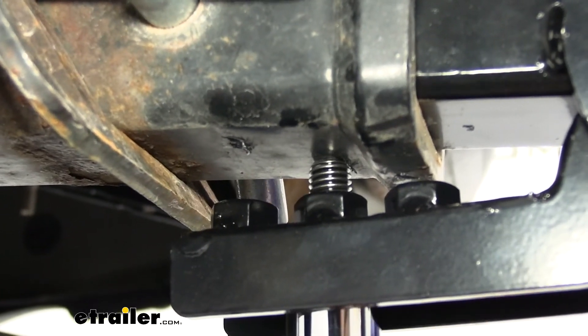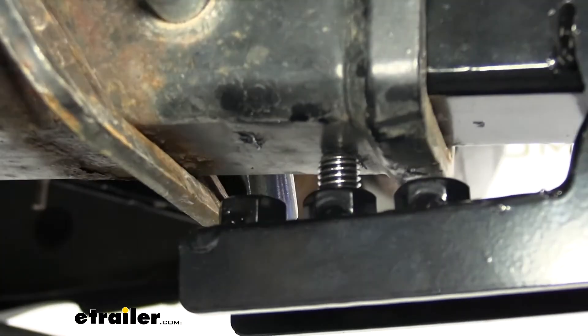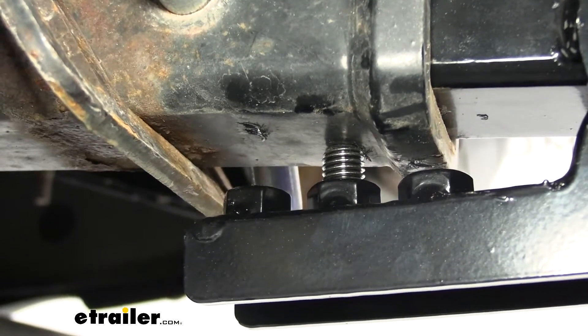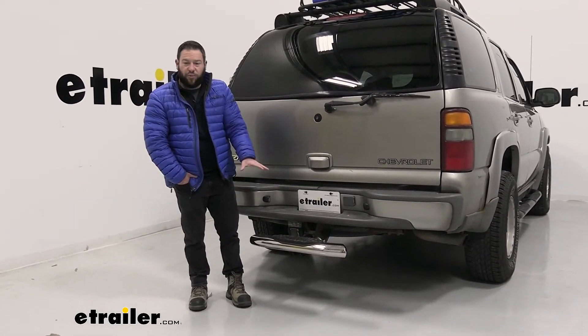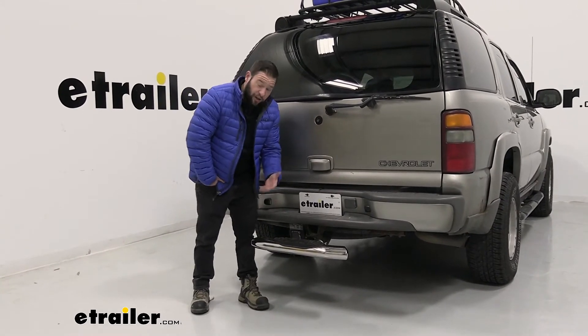You can see as I tighten it down, it starts to walk — what I mean by that is it shifts over to the side. So that's where I'm going to stop tightening it down, and that's going to be as much anti-rattle as we get. Now, it sounds like we were kind of trashing the anti-rattle bolt, but it does help out. It might not help as much when my whole body weight's on there and I'm shifting back and forth — it's going to cause it to move a little bit — but it is going to help you out when you're going on the road.